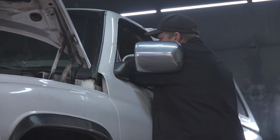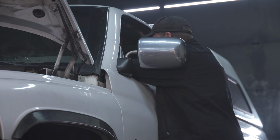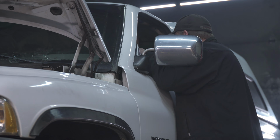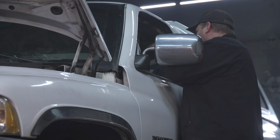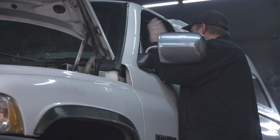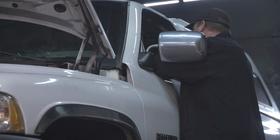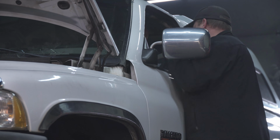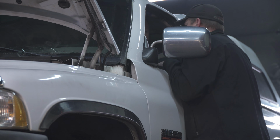The only other thought I had is you could tune the fuel where you think it's there and do a power run where the max EGT only hits 1250, and then you could leave it at the same fuel setting for the next one and see if the EGT is lower and if it makes more power. And just the max during a loaded to 3200 run, that would be consistent.